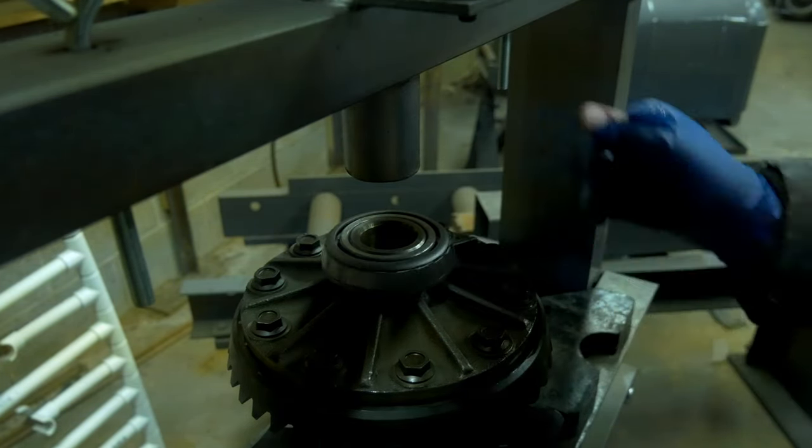If you're changing gear sets, if you're changing the ring and pinion gear while you're in there doing all this, it's a necessity. It is a requirement. You absolutely have to mark the gears and find out where they're interacting with each other. And this is kind of another thing. You can find a lot of other videos about this where things just work out perfectly. Unfortunately, it worked out perfectly here.